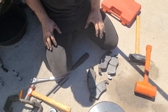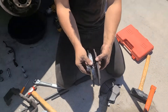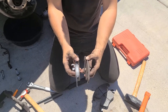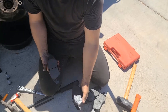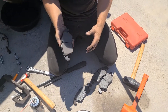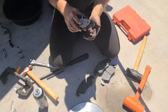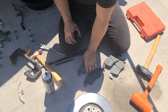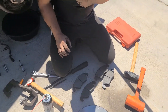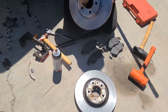Here are our brand new brakes and rotor next to each other. Let me showcase the old brake pads — you can see how thin they've gotten, definitely down to the wear sensor, while the new ones are three to four times as thick. The originals on the car were semi-metallic; I got ceramic brakes. I love ceramics — I think they last longer, they're quieter, and they stop better. On the back of the new pads there's a 3M-style coating; I'm going to put some grease on there to keep them from sticking.